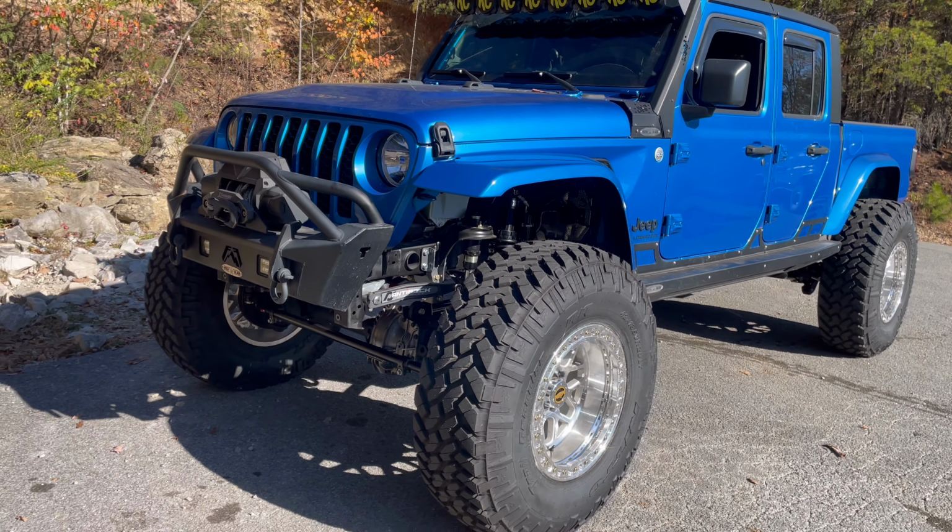Drive shafts are both Adams drive shafts. Now the rear one, you'll notice, is kind of funny. We've got an Adams rear section and then a Knoxville Driveline front section. So when he ordered this kit, he ordered it with a one-piece rear drive shaft. And what we had was contact here in this mount for the carrier bearing, which we didn't know was gonna be an issue. So the drive shaft right here, when it came down, was contacting this when you hit a slight bump. So we had to contact Adam over at Knoxville Driveline, and he cut down this rear section from Adams and then put the carrier bearing two-piece kit on here, and then we got the front section to work just well.